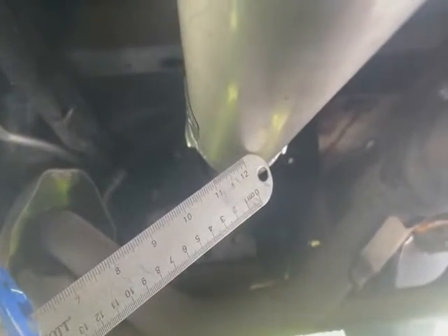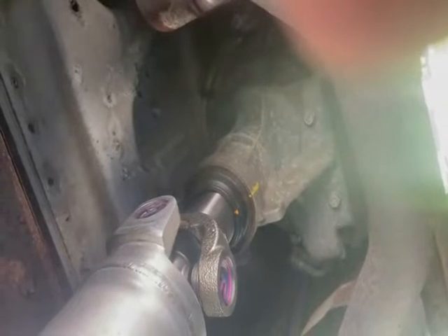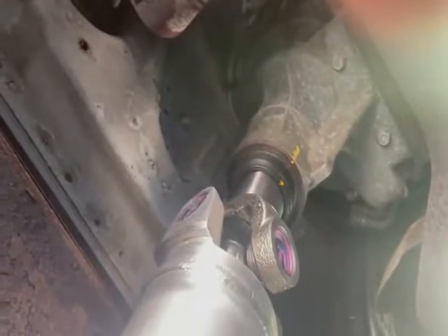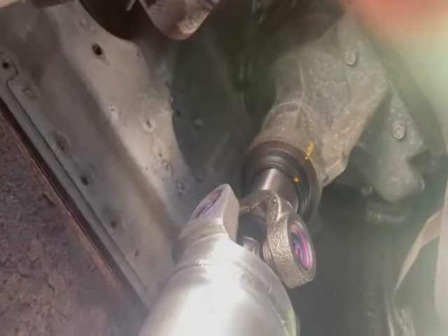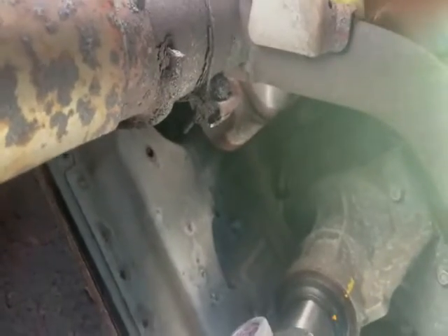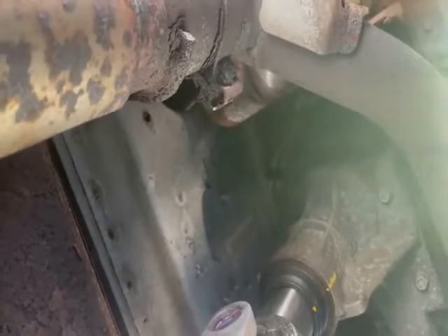You also want to check your transmission mounts — mine is very tight. There has to be a little bit of movement, measured in thousandths of an inch. Mine has hardly any play — it's not a perfectly tight welded fit, obviously, there's a little bit of yoke where the splines slip in. But if I move it up and down it goes click click click — that is a good spot to induce vibrations in the vehicle.